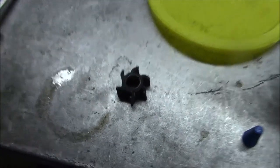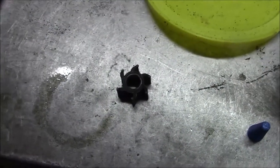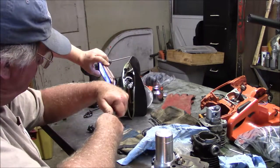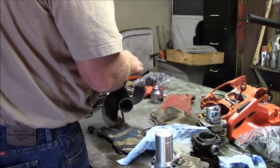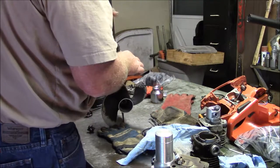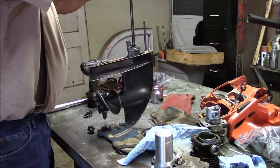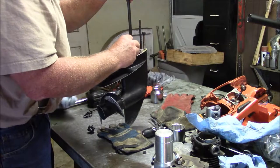What I found wrong with a 110 had nothing to do with the 110 itself - the fuel tank wasn't venting and I spent an awful lot of time trying to chase the tune as it was going lean on me. Kind of embarrassing for a person who's supposed to understand two-strokes. Make sure you got this - this goes kind of like this. This looks like it needs to be replaced. Really, the reason that thing exists is so it deflects stuff from getting into the bearing. And then these guys go right back on and we start the whole game again about trying to get it into the motor.